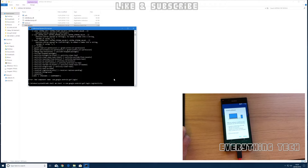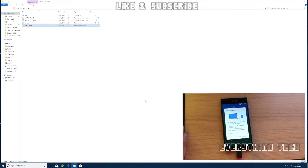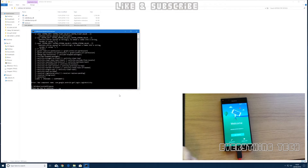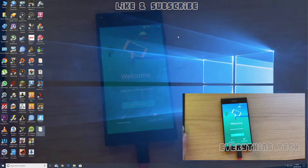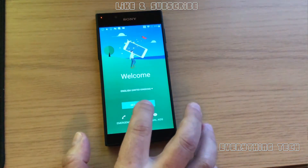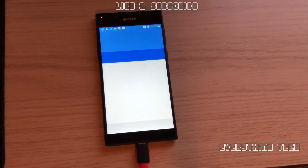It will have a fail message at the end — an error saying 'bad Google login' — but don't worry about that. I'm just running it one more time for good measure. Then cancel that and set the phone to Transfer Files mode — as you can see it's on the bottom right of the screen. Now close everything and go back to work on the device, because everything is pretty much done. We need to reset it, but apart from that everything is done. Press Next, get back to the welcome screen, press Next again and it should let you through to the next section.